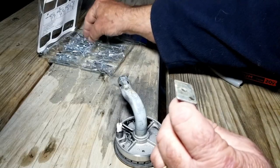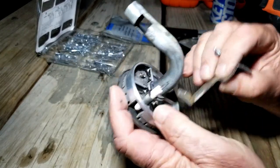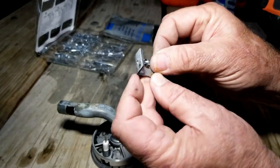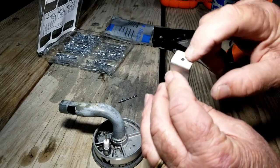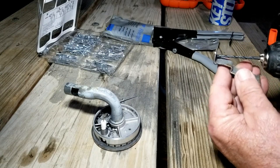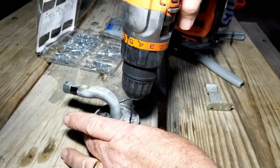The metal is soft and the screws strip easy. The holes are just a wee bit too small for the rivet so I can't get that in, so I'm going to enlarge the hole here on the burner itself. Hopefully this all works — otherwise I'm going to have to replace the burner, but it keeps coming apart and the screw thing is stripped, so I'm going to drill this out just a little bit, and then the same thing on the other hole.